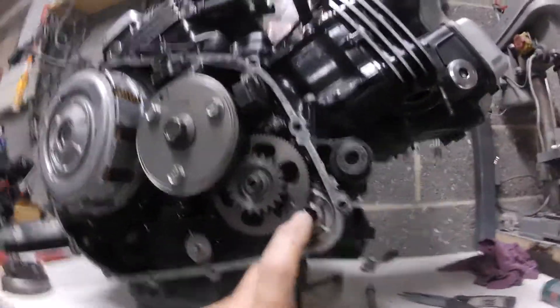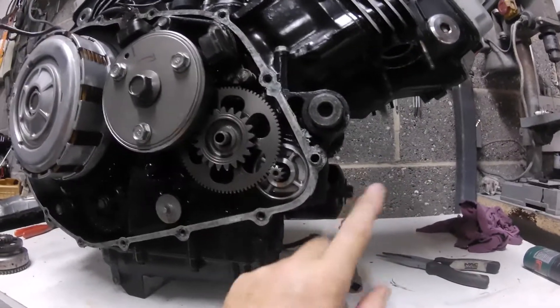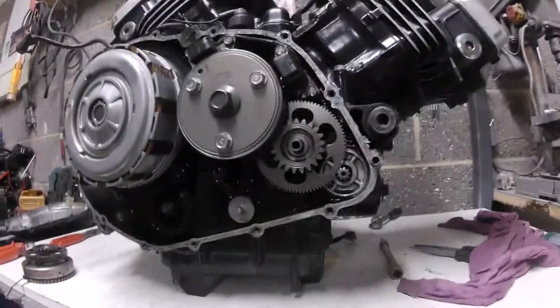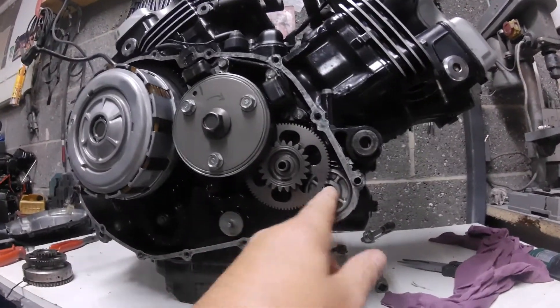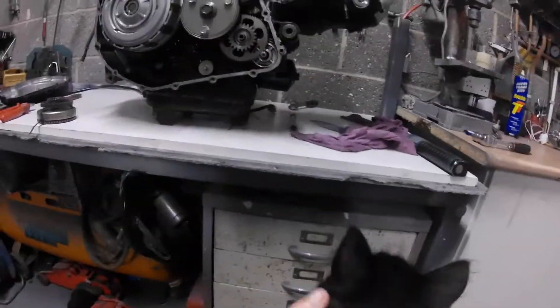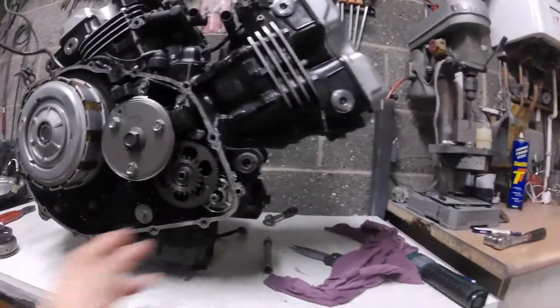The reason I changed mine: when I first got this bike it leaked oil past the seal in here, and oil had gotten into the motor itself and wrecked it. That's what led me to look for a replacement motor, which is how I found out about the Magna starter motor issue — I actually tried one on without doing my research, thinking they were all the same. They're not: the correct rotation is clockwise but the Magna starter rotates anti-clockwise. So heads up for anyone struggling with a starter — just go and get a VFR 750 starter.